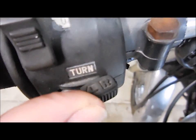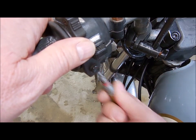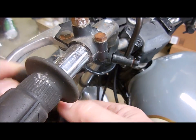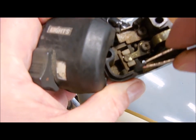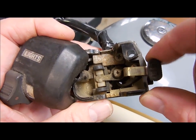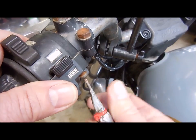What the kit includes are little rubber bumpers that you install on the switch so it becomes a momentary switch. You need to open up the switch to modify it — there's just two screws on the bottom, take those out, and the switch housing slips right off the handlebar. With the bumper pads installed it becomes a momentary switch, and I can install the housing back on the bike and put the two screws back in.